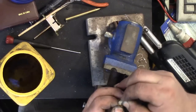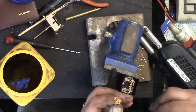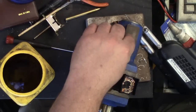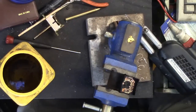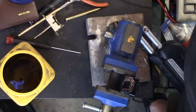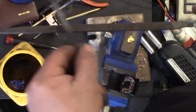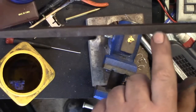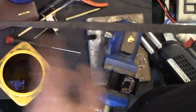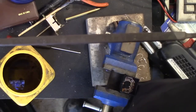And of course, any heat you start getting from the bad contacts just cooks the grease even more. See, that stuff isn't even coming off, so that needs a cleaning. And if you're going to use a file, you do not use a cross-cut file. Or a double-cut, excuse me. A double-cut file looks like a crosshatch pattern. You've got your main lines running across, but then you've got this second pattern going across. When you file with something like this, you're going to get the gouges. If you want as flat filing as possible, you need a single cut.